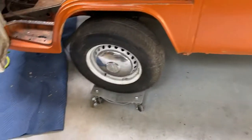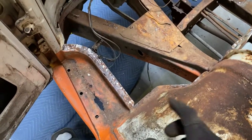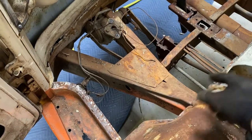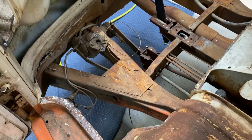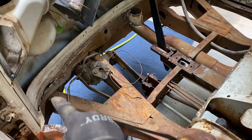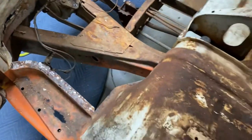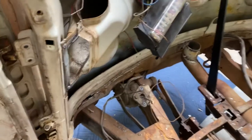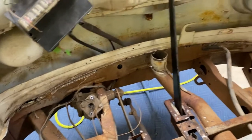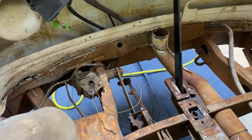Some pretty simplistic tools. There's a learning curve in understanding and knowing where the welds are to begin with. It's straightforward — it follows the perimeter, with some welds in the center for reinforcement, structural, and crash purposes. The toughest area is along this line here — it's so easy to booger this up. The proper way would be to have a drill or a spot weld drill tool, which I don't own, but you can use a drill bit to pop these out.